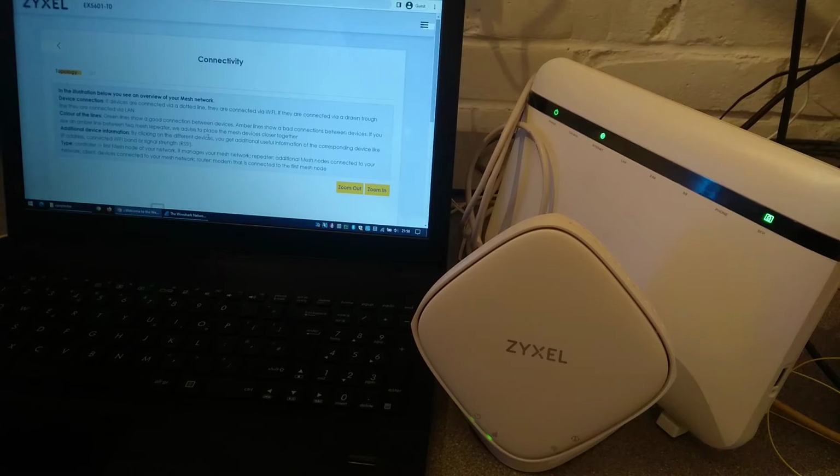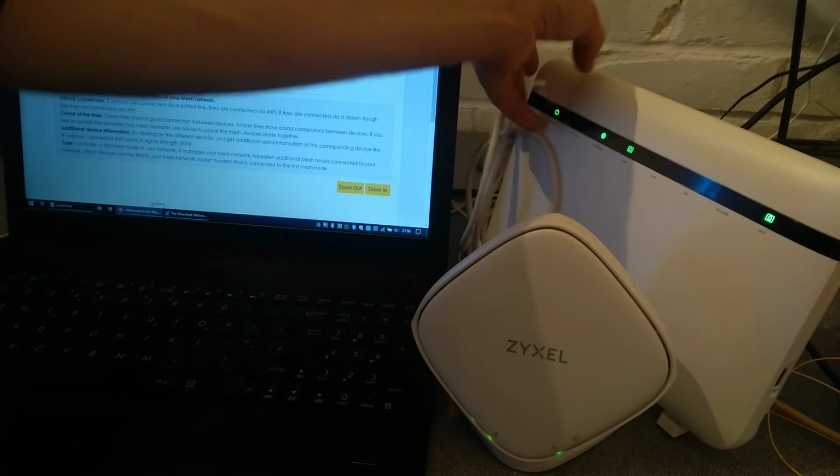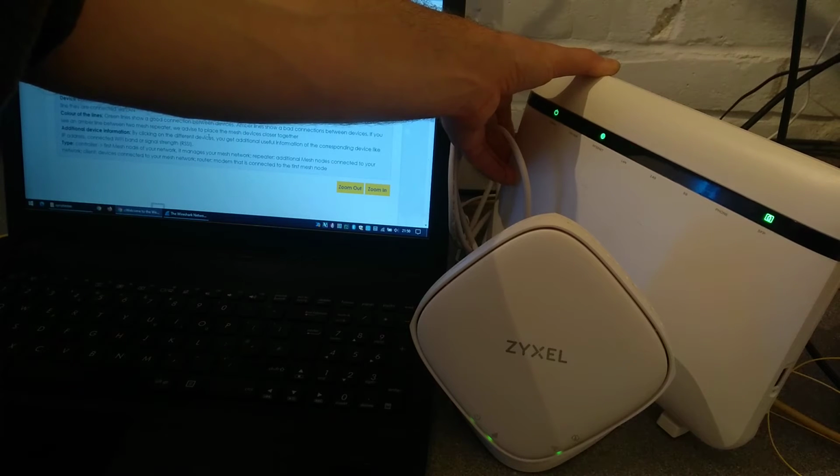So I'm redoing the speed test, and if anything I'm getting marginally quicker through the mesh wireless point. I'm definitely getting quicker on the upload on that. So I shall perform that test again. Yep, a gigabit on the download, and definitely above the 880 or whatever that I was getting on the upload, again 908. So this, at least with my laptop, with Wi-Fi 6, performs better than the router itself. Let's turn wireless back on the router and then test the wireless repeating performance of the mesh node.